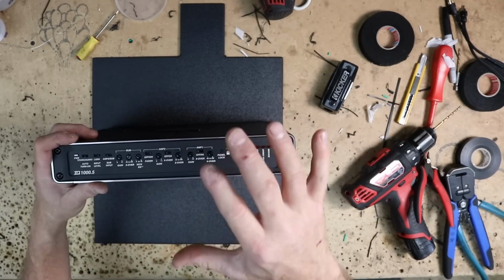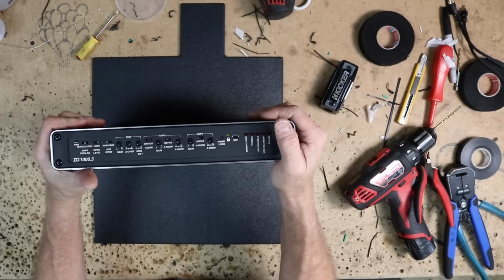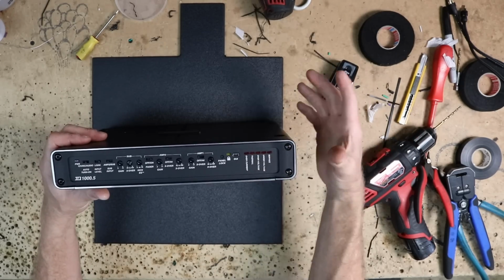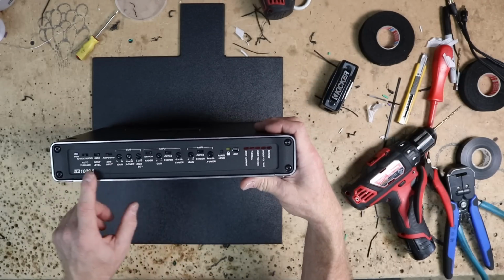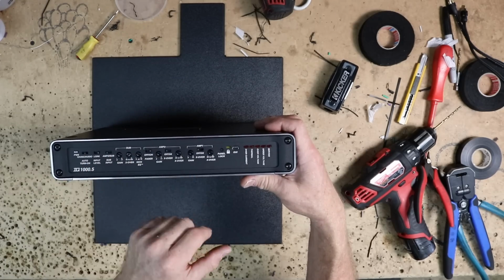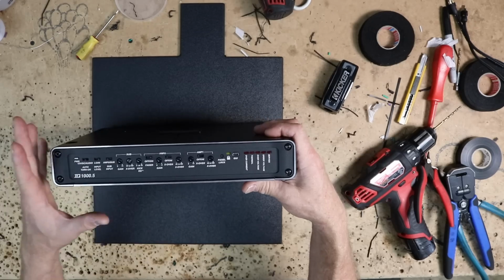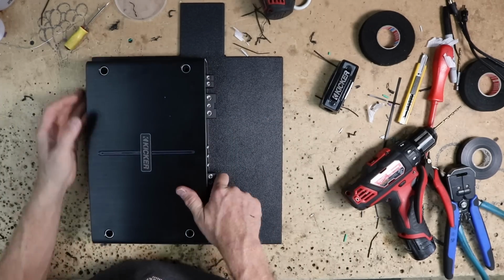There are several things about this amplifier that are extremely unique. You don't have to use the DSP that's in the amplifier, although I don't know why you wouldn't. If you want to just hook this up as a conventional amplifier, believing that it has no DSP, that's why a lot of these controls are on here. You can set your crossover, your gains, you can flick all the switches, but the reality of it is you only have to flick a couple of them. Over here on the turn on, the input level, and then the rest is going to just be controlled through the software. So now that we know that, we can move forward with our mount.